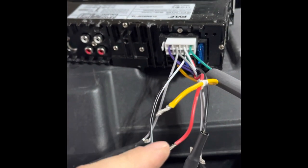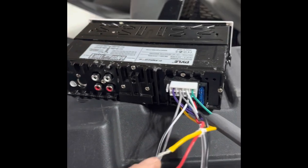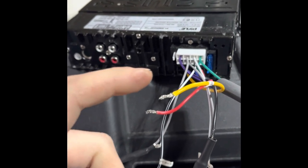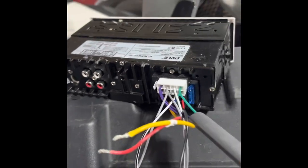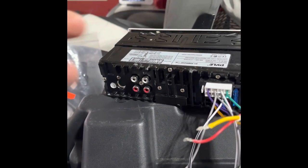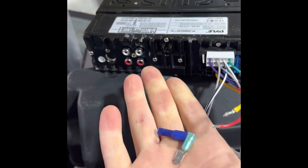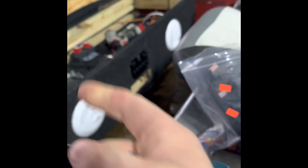I wanted to note — I made this mistake because I didn't read the diagram at first. You're going to want to run your constant and your switch wire for this. It's called Yellow B, and then accessory or ACC. Basically when you switch on the radio, one power wire is for an internal battery and the other is your constant power. I'm going to cap and put connectors and shrink tape on this and just have a connector on the power side over there.